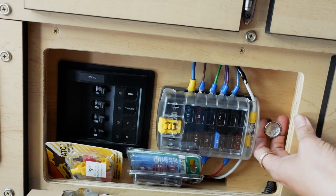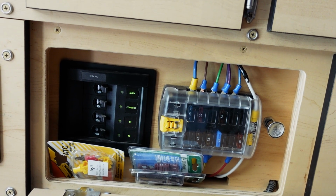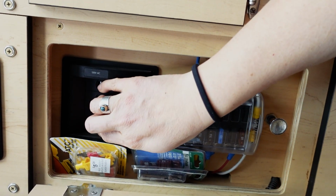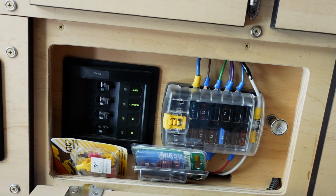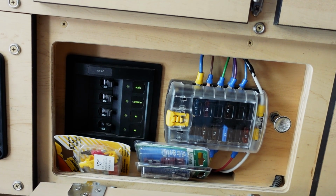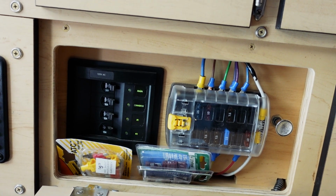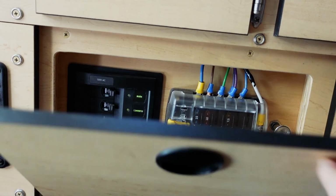So when I turn the kill switch on, and it's in the out position, that's what turns everything on. So right now my lights will turn on, my refrigerator turns on. You'll also wanna make sure that all of your breakers are in the on position. That just ensures that everything is actually functioning properly. I like to carry extra fuses. It's not typical that I need them, but it's really good to have in case one of the fuses trips. We're gonna go plug into shore power, make sure the battery is topped off, and then we're gonna move to the next step of getting the camper ready.